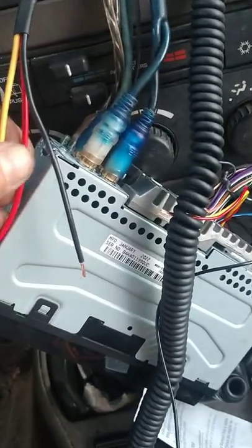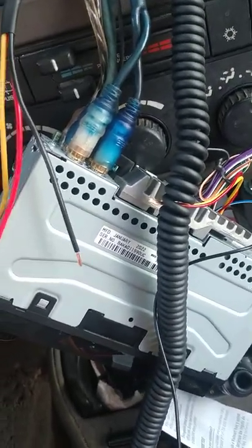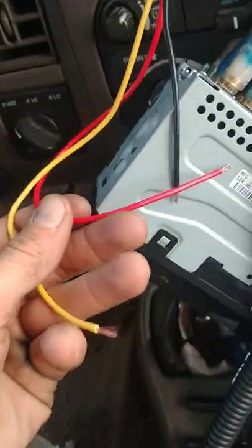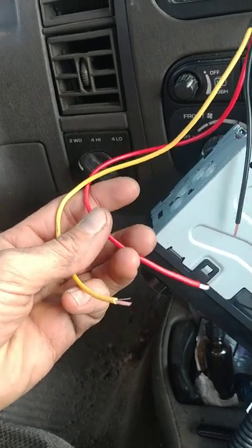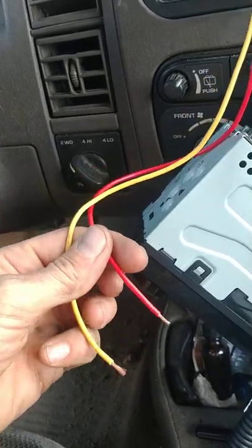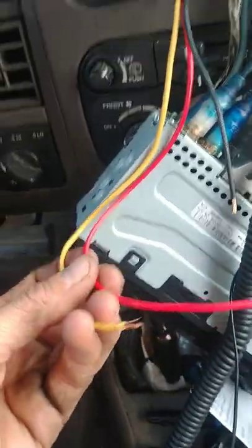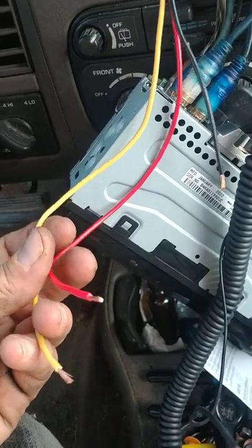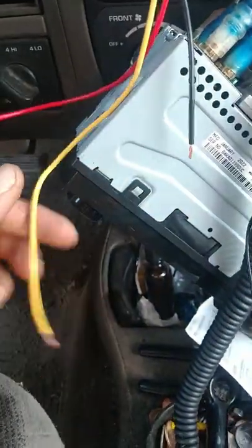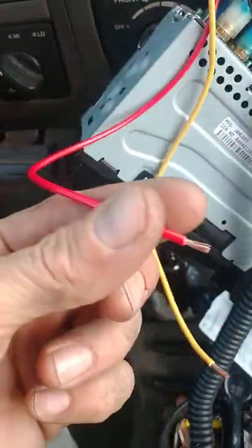So that's my fix. The video is actually about the memory. For those of you who don't know — if these two wires are backwards, your stereo will turn on but it will not hold the memory; it will reset every time. So the best thing to do: take the stereo out, and rather than cutting the wires, if you have an access point you can stick a probe in like this one. I would recommend doing that first to save yourself the trouble of cutting and stripping wires.